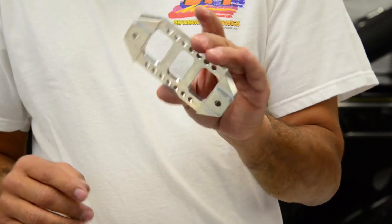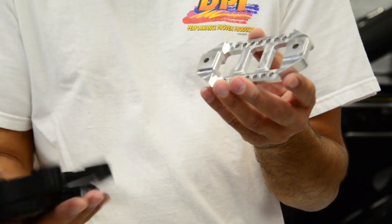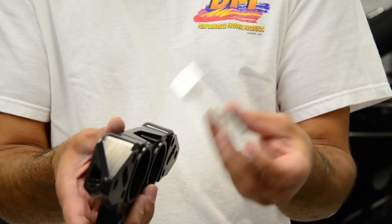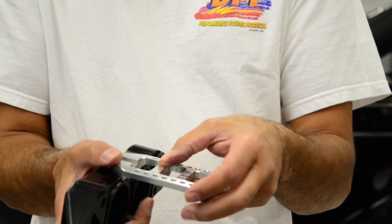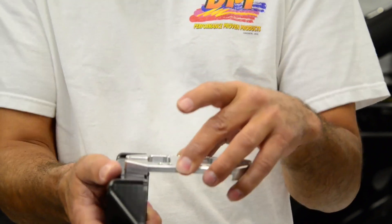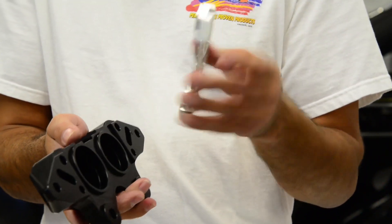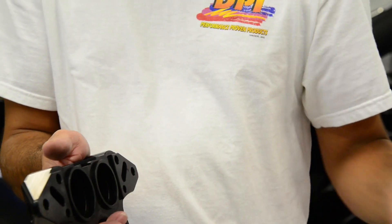Next, we've worked on this bridge here. With a locking device, we're able to lock it into the center body and into the outer half. It'll lock in like that and have a fastener that goes through here. That's able to control shear of this caliper trying to shear. We worked hard on getting flex of the caliper and making it stronger, and with this locking bridge device it's been a really big improvement.